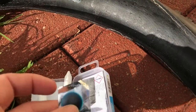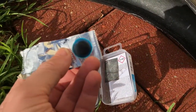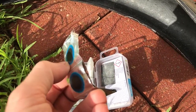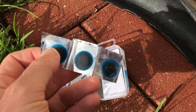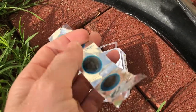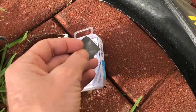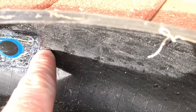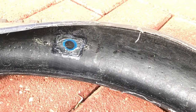The patches themselves — maybe they're a little bit thicker than a standard tube patch, maybe not. I'd say it's just a standard tube repair kit patch, so maybe a little bit stronger, but I don't think so. When I peeled the other one off it didn't show any signs of being more robust or anything like that. A good quality puncture repair kit probably has the same or similar patches — they're okay. The kit also comes with a little bit of sandpaper. Don't go too hard on it — I've exposed a little bit of the wire or Kevlar in the tire from sanding off the old glue.